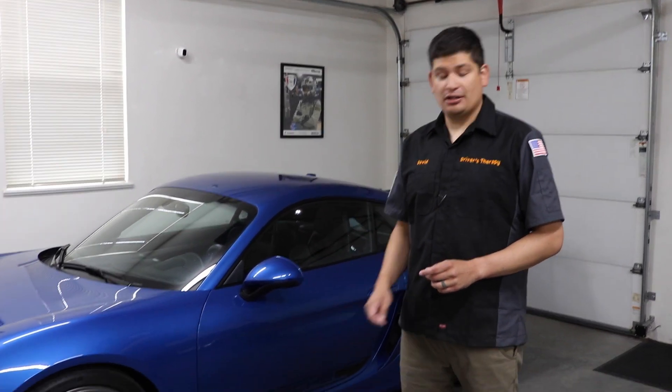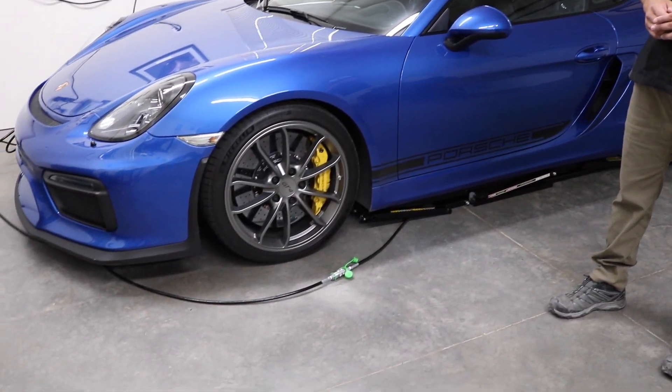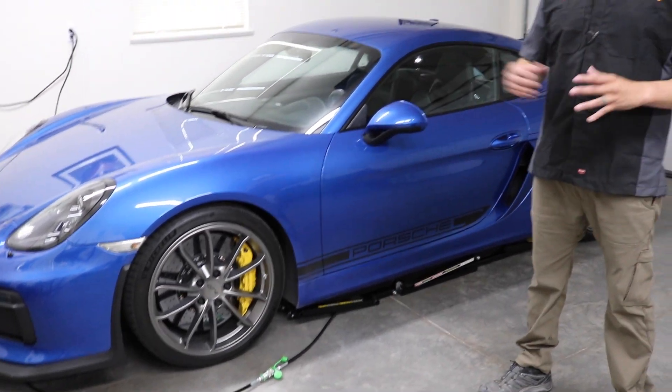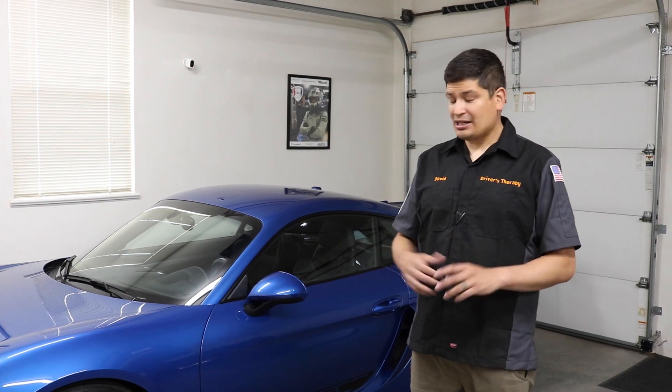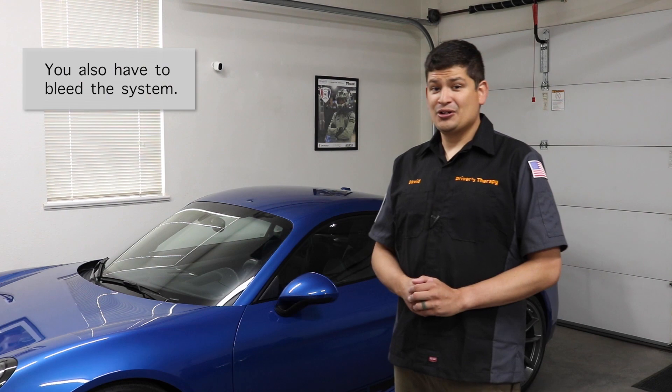We're back — this is day two. I'm going to be honest: QuickJack didn't really give you forewarning of everything you have to do. You have to put together all the hoses and apply Teflon tape. Looking at previous videos, some kits came with Teflon tape and a nice organized tray of parts. This kit had no Teflon tape and fittings just thrown in a little box. On top of that, you have to go out and buy about $20 to $25 worth of automatic transmission fluid because they don't provide that. So there were a couple of things that took a full day to prepare.